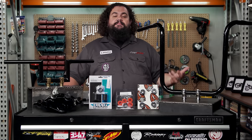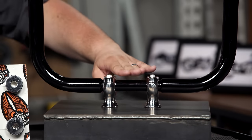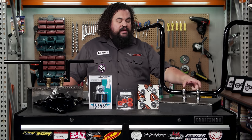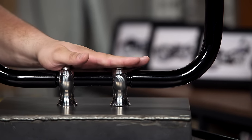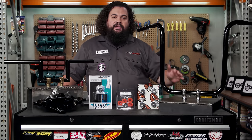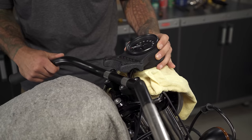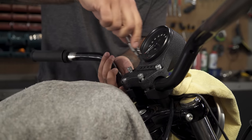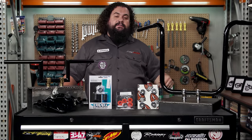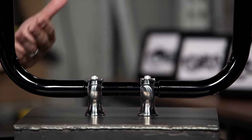Another cost or complexity can come back to risers. We talked earlier about how we wouldn't normally use a two-piece riser on a stepped bar simply because we're trying to cover up that area, but there's another reason too — we also need greater clamping power. So instead of using a two-piece top clamp, we would use a one-piece top clamp to provide greater clamping power. Another bar construction feature to look for, especially for a high-rise bar, is knurling. Knurling is this cross-hatched pattern machined into the handlebars that allows the bars to get a bite on the risers. As the bars get taller, you're able to exert more leverage on that clamping point, so you don't have bars slipping inside the risers — which is both annoying and severely unsafe.